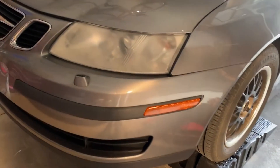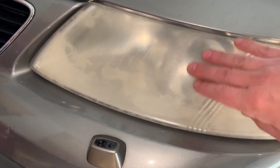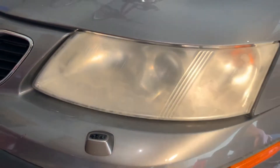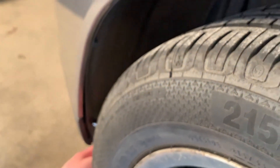This video is going to show you how to replace the headlights on a Saab 9-3. As you can see, the plastic is really in bad shape, so we're going to put the new headlights in. We're going to have to remove the front bumper to get access to all the screws — there's one here, one here, and one right at the top that you can't quite see. We're going to do this on each side.